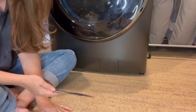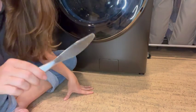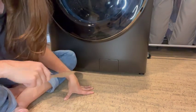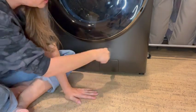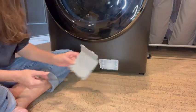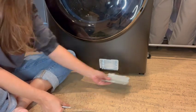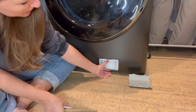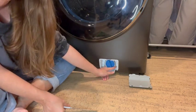The first thing I'm going to do is take off this little cover right here. To do that, it says to use a flathead screwdriver, but around here I'm more of a kitchen knife kind of girl, so I've got a knife. You just have to put it right here in the top and this little door just flops off. There are little hooks on the back, so we'll make sure to put that back properly when we're done. This little lip right here just folds down and then you just unscrew this.